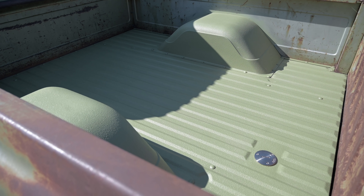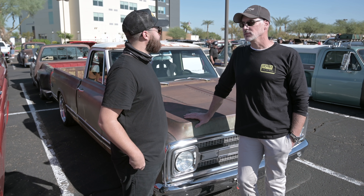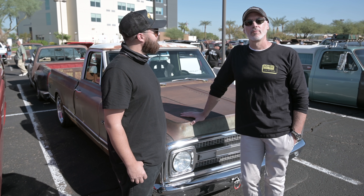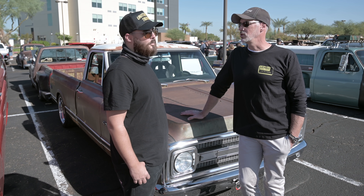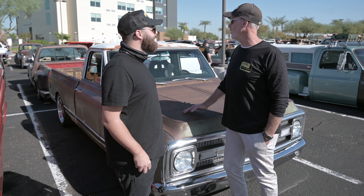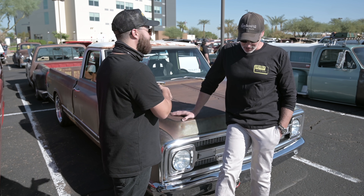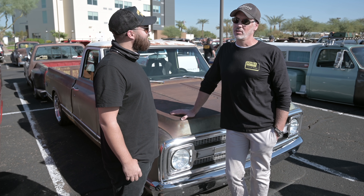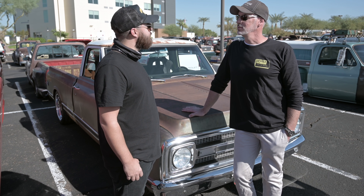You built it to drive — to really rip up the road and maybe even race it. A key component to that is the transmission. We've got a Bowler Stage 2 in it — Jesse specced it with Bowler and it's dialed in nice. We're running 3.89 gears. So this truck gets out of there quick, but on the highway I'm running 80 miles an hour at only 2,100 to 2,200 RPM. Do you know what kind of gas mileage it gets? I don't, and I'm not sure I want to know. It's got an 18-gallon tank and there are days where it feels like I've only been driving about an hour. But you can pull up at any gas station, put high-octane in it, and roll — it's functional.